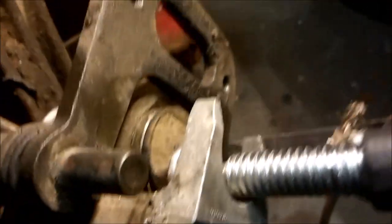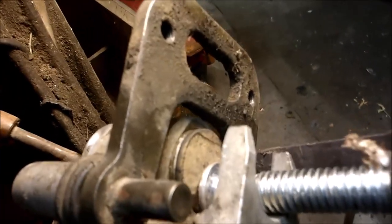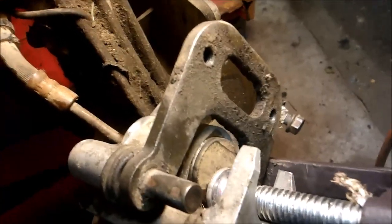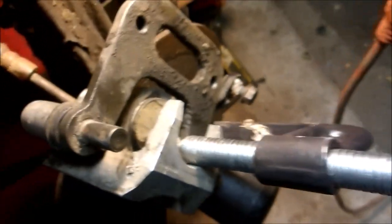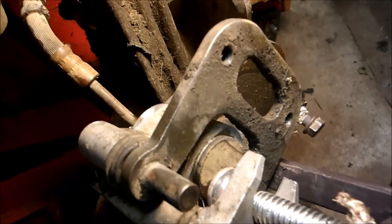Keep in mind you can use this to adjust your brakes too. What I like to do is take a c-clamp and make sure that piston will move in as I'm turning it - you can see it's pushing in. These pistons like to rust up, so before I put my brake pads on I'm pushing this all the way back, which also makes it easier to install the pads. I did a brake job on a guy's scrambler and his brakes locked up - his pistons had corrosion from sitting unused. All I did was bleed the brakes, push the pistons in, and freed them up with PB blaster or WD-40.